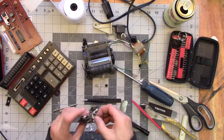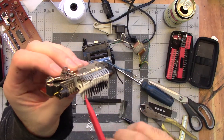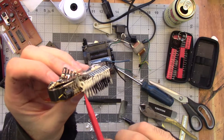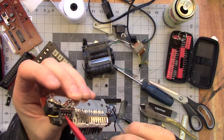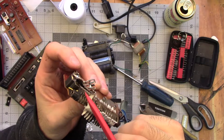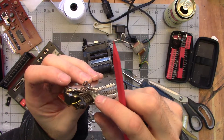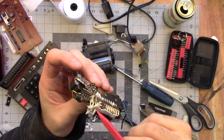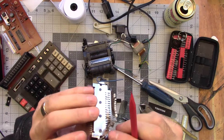Here's the hammer - that strikes the paper, and it was pivoting on an axle that I pulled out. There's these hammers in the back that are actually doing the hammering, but they only lift a little bit. What they're doing with the white thing is the white thing's a lever that translates that little bit of movement into a lot of movement, and hammers on the paper with the plastic tip. So inside this sucker, we still gotta figure out how these metal guys move in the first place.